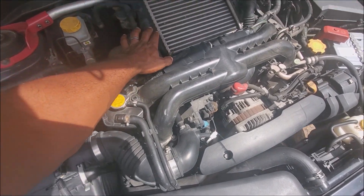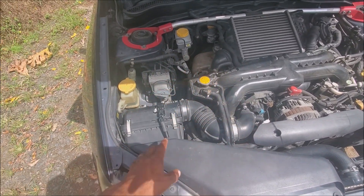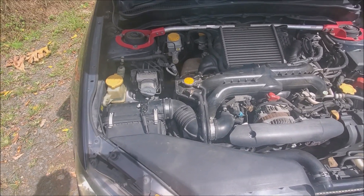I'm going to install a dedicated air temp sensor on the intercooler cold side — that's where it's supposed to be anyway, not in the MAF housing, which gives an inaccurate reading for speed density. Right now I'm going to throw on a base tune and show you that the car runs without the MAF sensor. That will be the basis for the next round of mods. My goal is to get the car consistently into the 13-second quarter mile or 8-second eighth-mile. The last time I ran a drag strip it was somewhere in the mid-14 seconds.